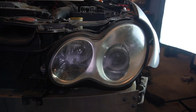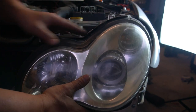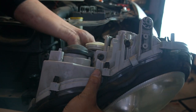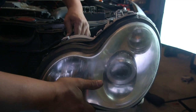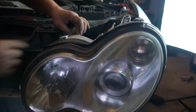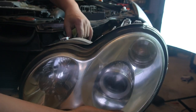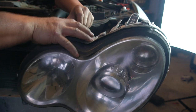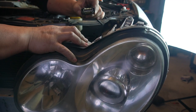With all three bolts removed, we can now remove the headlight. Just one last thing before you pull it straight out — there are two connectors that you need to remove as well. At the bottom you're going to have your air hose and also your headlight harness. Just pull it forward a bit and then you'll see your headlight harness right here. I'll remove the headlight harness first — there is a tab on both sides, you just simply press on the tabs and then wiggle it out. The harness just comes out.